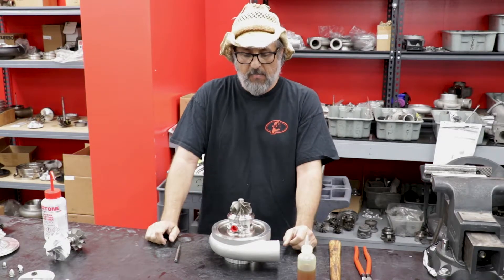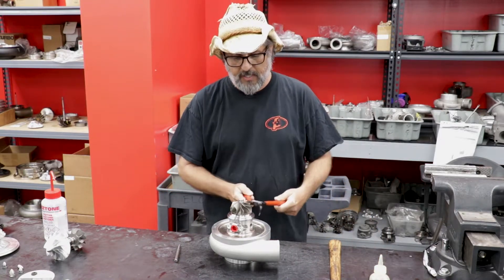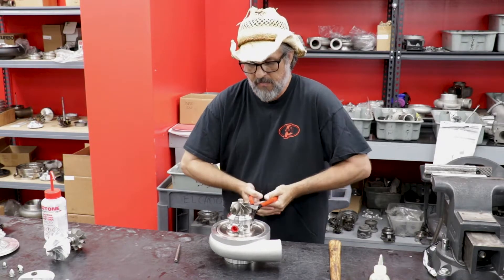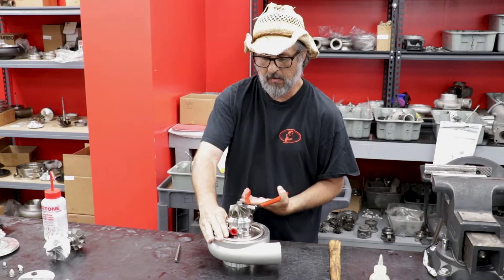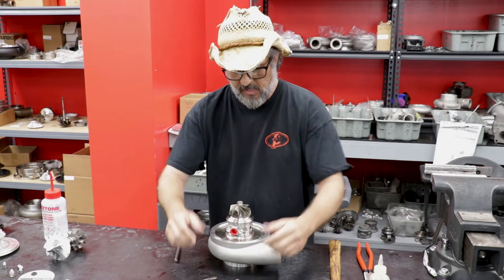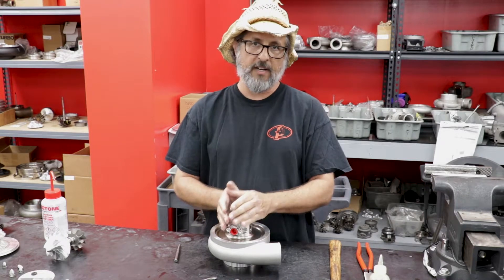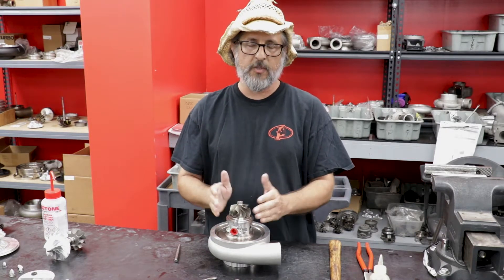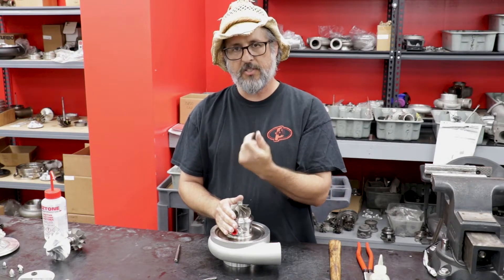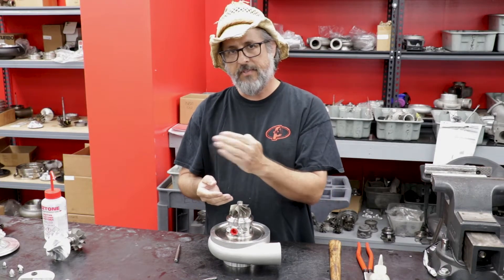Now that it's in, I'll show you how to properly remove it. I just staked it so it's going to be tight to break loose — that's where the big snap ring pliers come in handy. Take the snap ring off. This is an important part because you can damage the compressor wheel very easily. If you pull the cartridge out at an angle, there's not enough clearance between the blades and the housing to let the blade swing out like that — the clearance is very tight. If you swing the cartridge out at an angle, you're going to pull the compressor wheel up on one side and ding it.